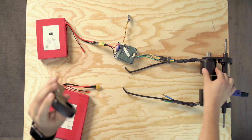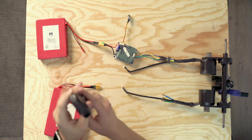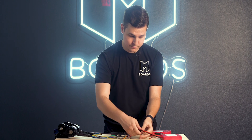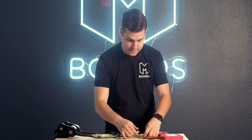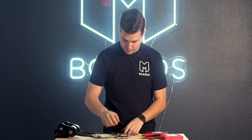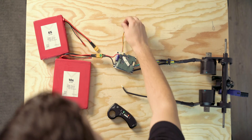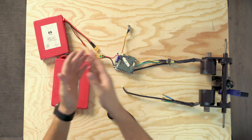So that's what's happening. Obviously it doesn't work, but if we use our trick and hold the brakes, it is actually working — so we know for sure our remote is paired, but it's not actually spinning due to the voltage mismatch. If we unplug the 6S and plug in our 10S again and turn it all back on, there we go. But what happens if you have a 10S battery and a 10S ESC and you're still experiencing these problems? We'll get to that next.